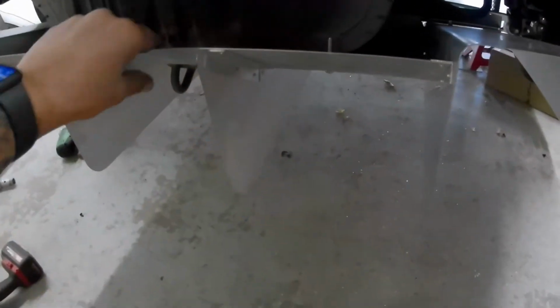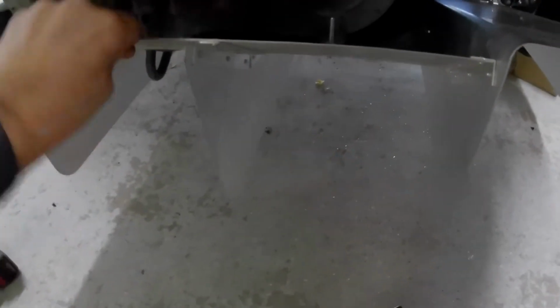There were holes on this piece of aluminum, but they're under here, so I can't see them. So I'll mark the holes from the top side once I get this out, and then I'll drill, and then I'll actually riv nut the actual diffuser. It's hard to film because this car isn't super high off the ground, but I'll riv nut the diffuser so that way, for some reason, if these bolts fall out, it'll still be sitting on here, and I'll still have these ones on the bottom. So the rear diffuser in this section is already pretty strong.